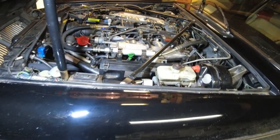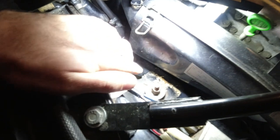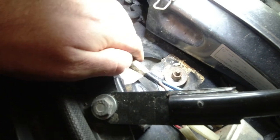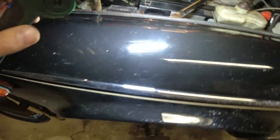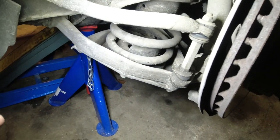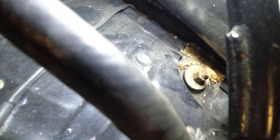We'll start on this side, which is where I didn't notice it too much, because I saw something instantly when I opened up the bonnet. See all that down there? That is the top shock mount disintegrating. Very, very common. Not that bad yet on this side, but it's almost gone. And here is that sway bar — it's still intact. They're quite cracked, but they're still intact, so they would not be making noise. But let's check the other side. It's even worse up here. There are big chunks laying there, so it's definitely, definitely disintegrating.